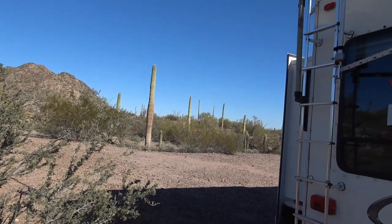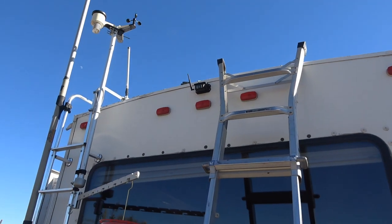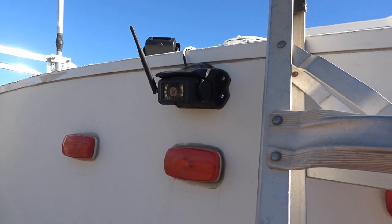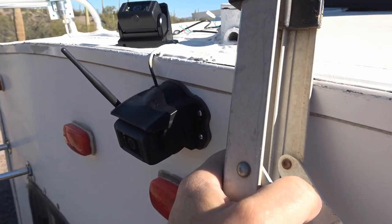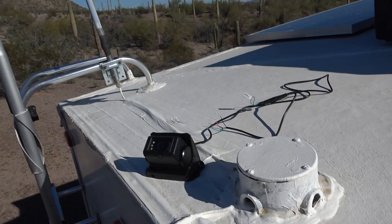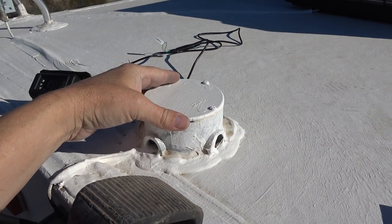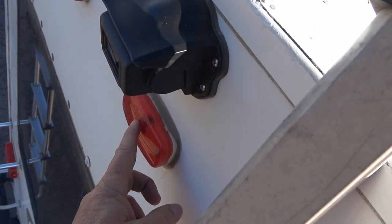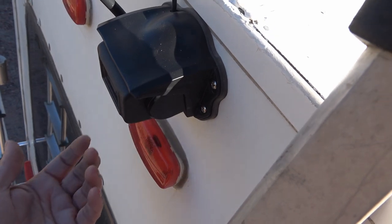It's a pretty nice day in the desert with not much wind, so I'm going to install the rear camera first. I'm going to replace the existing one from the BT-7 system. I tried to pair the old camera since they look identical, but couldn't get it to pair, so I'm using the one in the package. I found power from an old system — there's a junction box with a cell booster, and I drilled a hole in the roof and ran down to 12 volts, making a power socket and switch just for this camera. Most people will probably use the marker lights and connect to power and ground there so the camera comes on with the trailer lights.